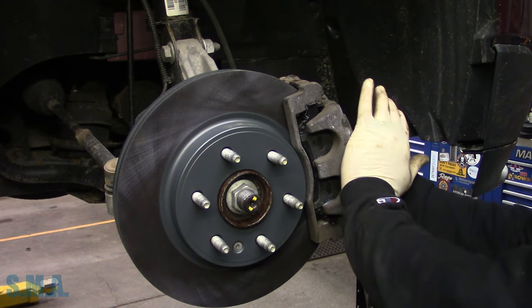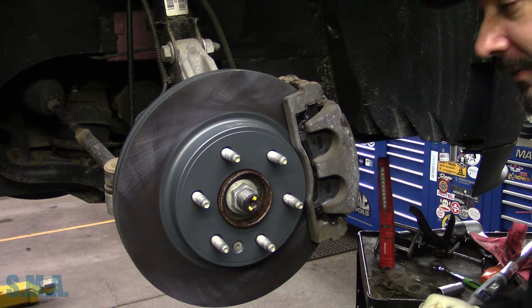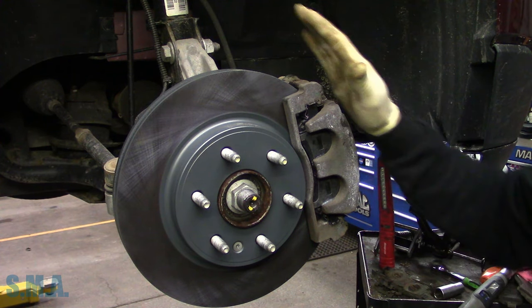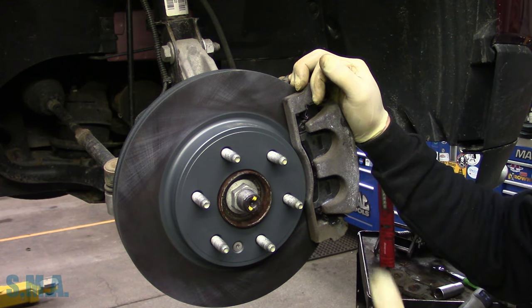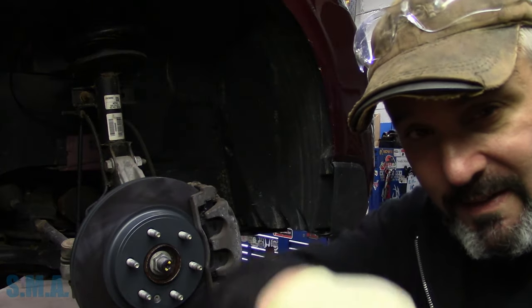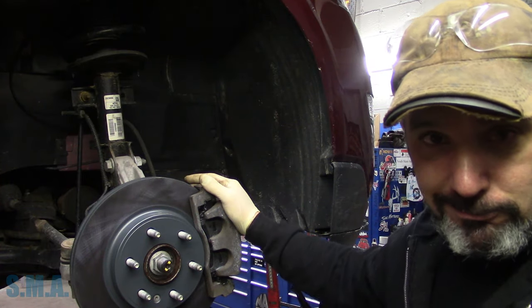So that's on — it's tight and it wiggles, which is good. Throw the wheel on. Pump up your brakes multiple times before you drive out of your shop. Make sure your brake fluid is full, then burnish in your brake pads according to OEM service data — on GM, that's driving at 30 MPH and applying moderate to firm pressure without locking up the brakes, repeated 20 times with ample cool time between each stop. That's what Chevrolet says. Leave your questions and comments below, subscribe, ring the bell — if I can do it, you can do it. Thanks for watching.